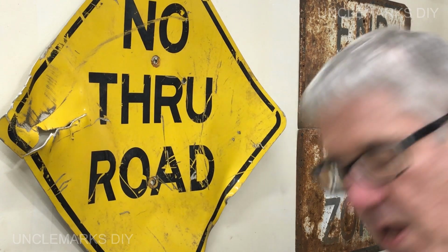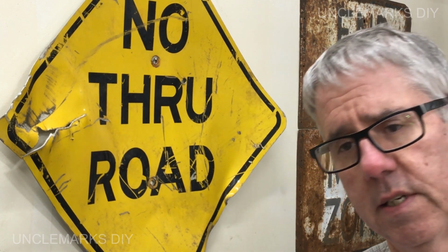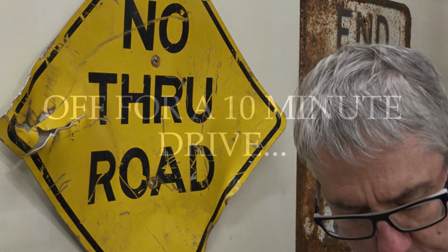Make sense? I believe what they suggest you do too is you're probably going to have to drive. Let's say you drive for 20 minutes, a nice good drive. Get back home, put it to park, and they want you to go into drive, reverse, try a couple gears. First, second, reverse, neutral, drive, park. With it running in park now, now go check it, see what it is, because that's going to help you quite a bit.